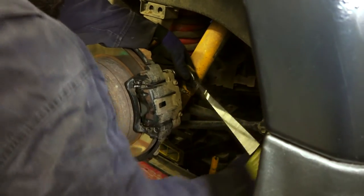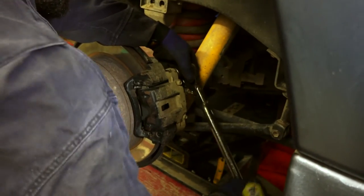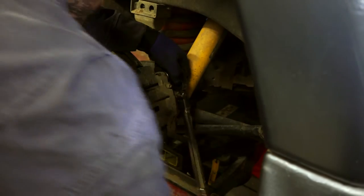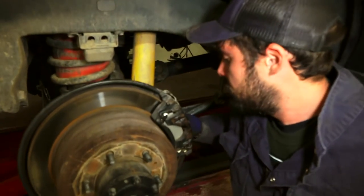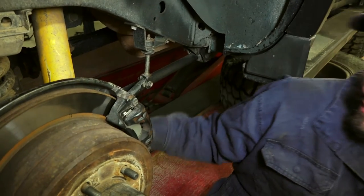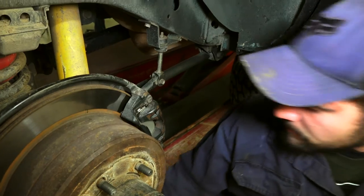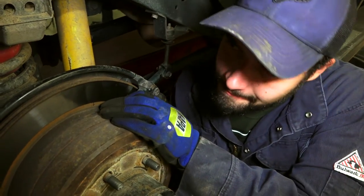Pretty much, that's the job done — basically tightening the two bolts holding the caliper. Brakes don't have to be bled because just a little bit of fluid squeezed out to relieve the pressure and fit the caliper with the new pads. Put the wheel back on and that's about it. Until the next video.